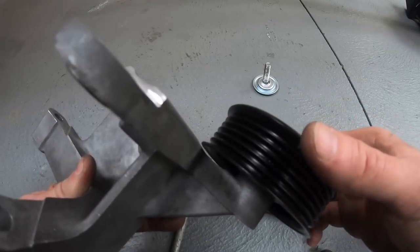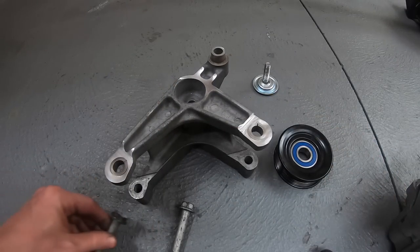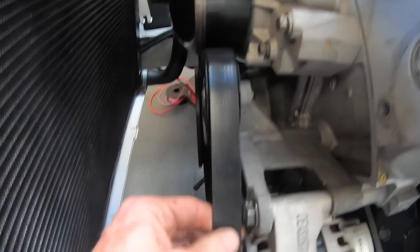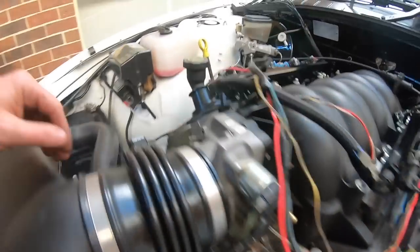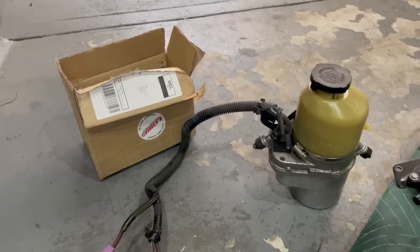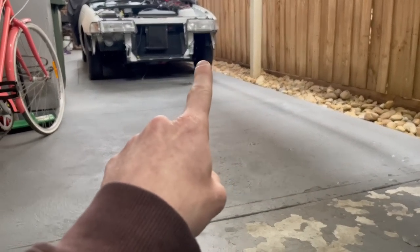Now there's plenty of room between the pulley and the bracket — that is how you get the belt to miss the bolts. With it all back together: with the notch ground out and the bolt machined down, it clears nicely. There's no way it's going to hit the top or bottom bolt. The belt fits up nicely — again that is a 6PK1385 if you have a 25% underdrive pulley, with nice spacing between the bracket and the idler itself.